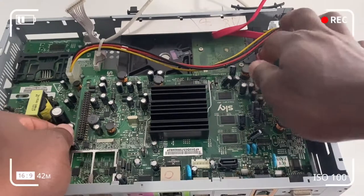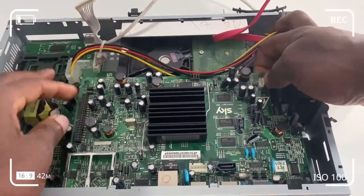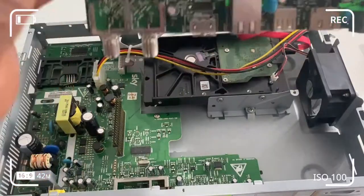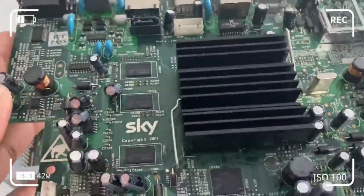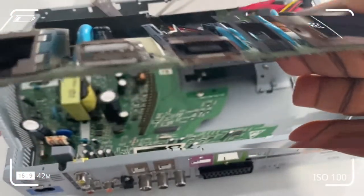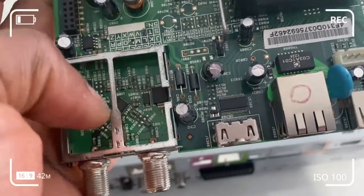After providing clearance for the cables, the next step is to take out the top board interconnect — just take that off from the bottom board. We've managed to get the main top board out. On here, which is what I've got in my hands right now, this is the board where you've got all your port connections — like your HDMI, satellite, internet, serial port, USB and so on. Whilst flipping the main board, I can see a chip that's been shared between the two satellite connections or ports.